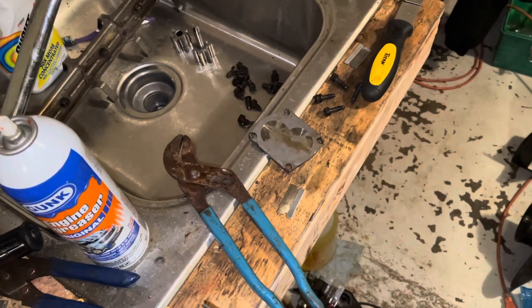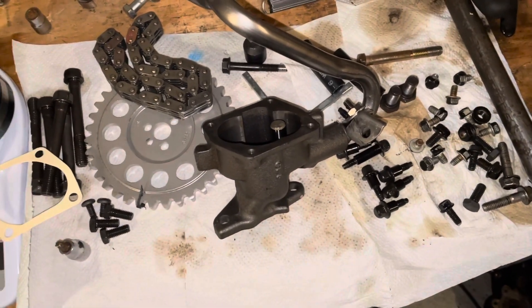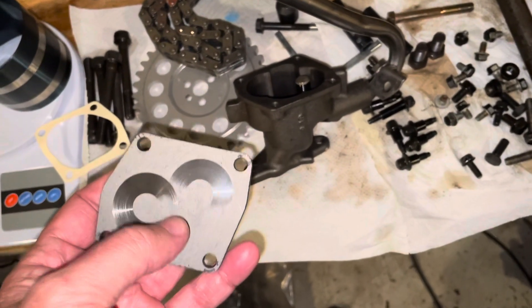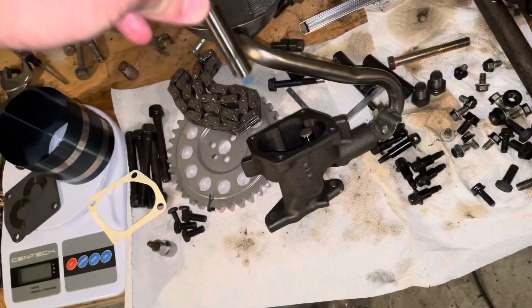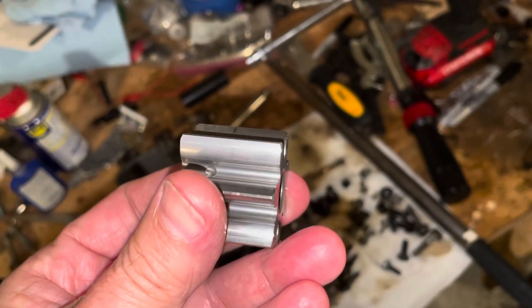There was actually a gasket for this oil pump in the gasket set I bought, so I'll change it out since it may never see the light of day again. This is the cover — you can see a little wear pattern on it, and that's fine. When putting things back together if you're not sure how they go, look at the wear pattern; it will tell you how it was oriented. Here are the gears — this one is obvious: the shaft goes down the hole. This is the drive gear, driven by the distributor shaft, and it goes in the oil pump first. The idler gear is not so obvious.